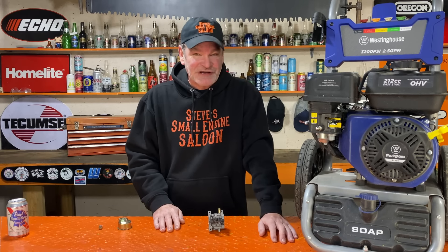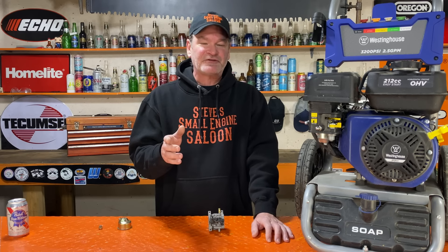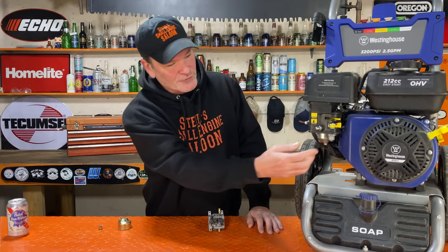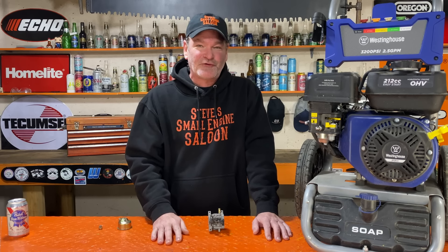If you have an external vent on it, then you're just going to have a big puddle of gas on the bed of your truck coming out the outside. I'm not saying that's going to happen to you, but it is very possible — I've seen this many times. All you have to do when you get that in your truck and you're ready to transport: it takes a fraction of a second to reach over and turn the fuel valve off. Done. That's not going to happen to you now — it can't flood through because the fuel valve is shut off.